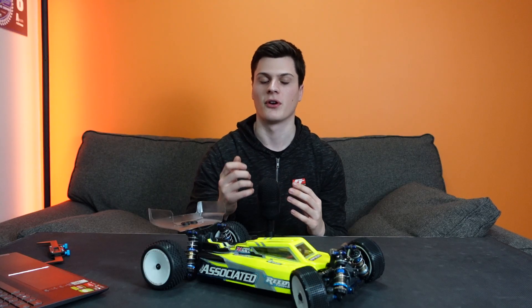What else can roll bars affect? They can also affect how quickly the load is transferred in your car, and the reason that's important is it affects how nervous and initially flicky your car feels around the centre. If you're running thicker roll bars, the car isn't going to roll as far, which means it sort of gets to its destination quicker when you first turn.